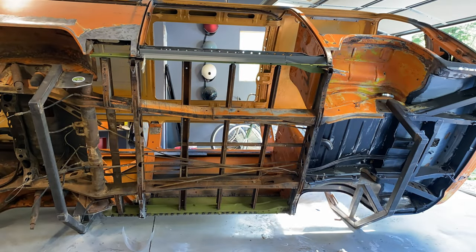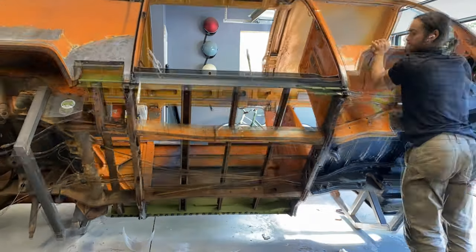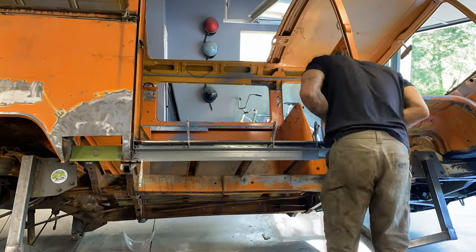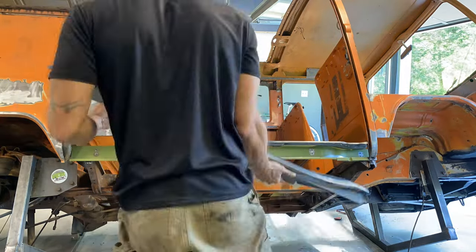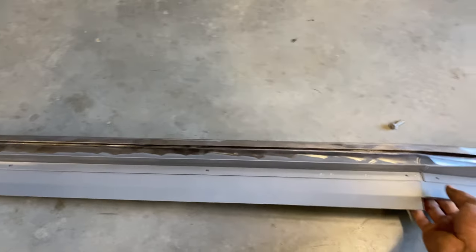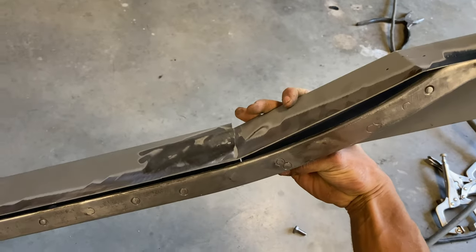With my B pillar in place, I was able to make sure that the track fit perfectly. So it was now time to begin connecting the top rail with the bottom rail. The first thing I did was make sure that everything was clamped into place where it was going to go. Then I tacked the front of the rail and the back of the rail and pulled it out, so my upper rail and bottom rail would come out as one piece and I'd be able to assess if it was going to work out.